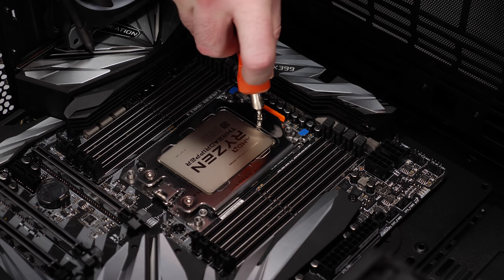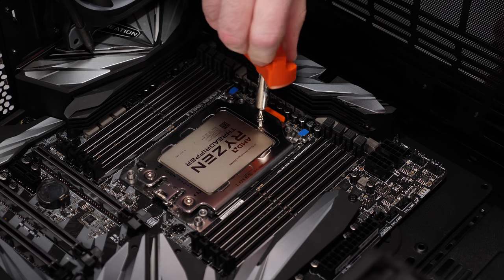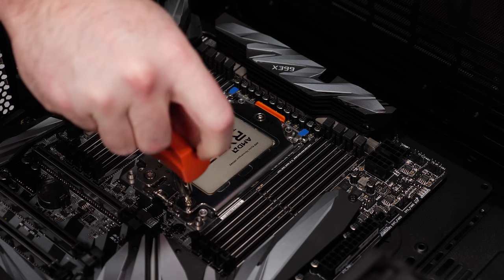For testing, I've got a truckload of data. While I tried to include as many CPUs as possible, I did run out of time to go back and retest the Core i7-8700K. I have results for a number of Intel's high-end desktop processors, such as the Core i9-7980XE and the 7960X. System specs will be thrown up on screen in tables — hit the pause button if you want to examine them. Basically, all systems were configured with 32GB of DDR4 memory, most running at DDR4-3200 with XMP timings, with no tuned memory timings in any of these tests.